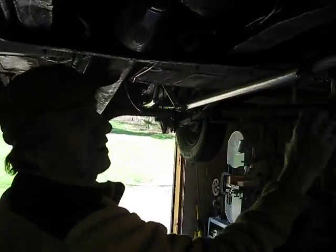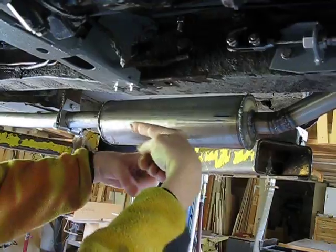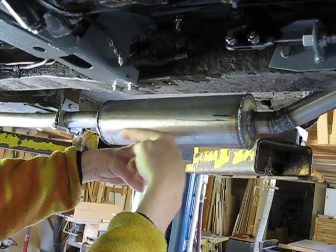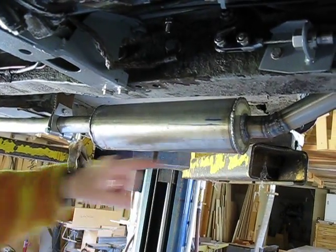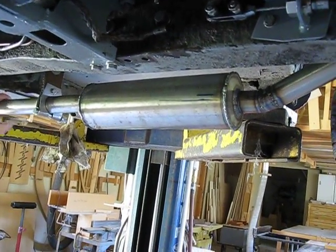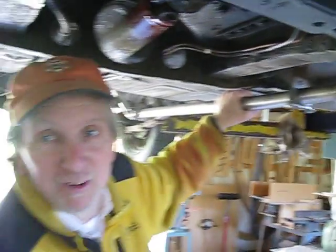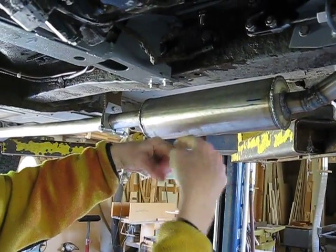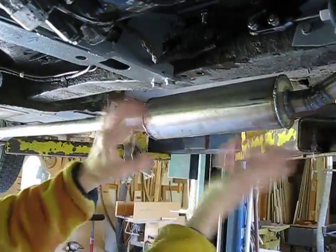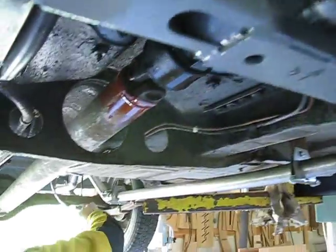Here's our nice stainless steel muffler — this is from a submersible well pump. I just ran two pipes inside there and peppered them full of holes. It seems like that's quiet enough for a muffler. Originally I just had it straight-piped through because I thought it's a small engine and it wouldn't be that loud, but it was really loud. So you put a couple baffles inside? Yeah, I just ran the two pipes in and peppered them full of holes — it gives the sound somewhere to go.